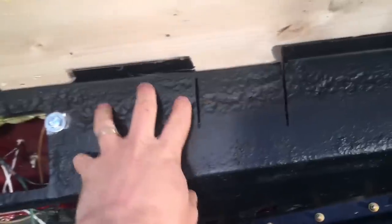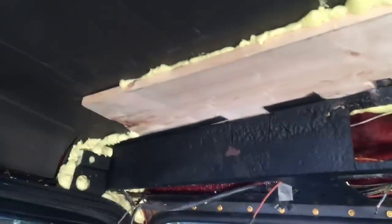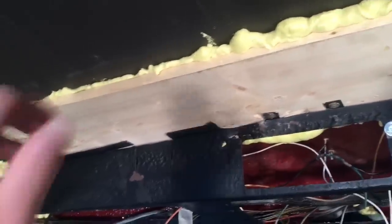I think that's going to work nicely - now we've got something for the cardboard to bite into all the way along. I think that'll hold it up just brilliantly. I put a board in, went and got something a little wider so there's more material to screw the buttons into, mounted it up there. It's going to be held in quite nicely, squeezed between the frame and the roof. I shot insulation underneath on both sides so it's as solid as the roof is now. It shouldn't move around, shouldn't rub against fiberglass, shouldn't squeak - a nice solid material to put the interior panel into.